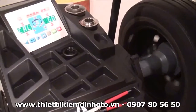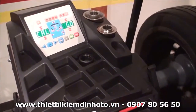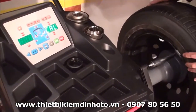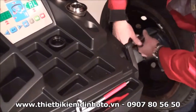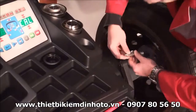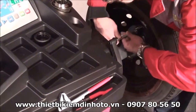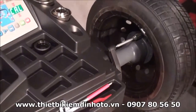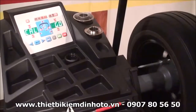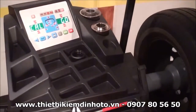This is our second spin. Again, I'm going to do the same thing — taking the weight and spinning it this way so it will be on the external side now. And perform the last spin. After this one, the machine will do two more spins to make sure the calibration has been done properly.